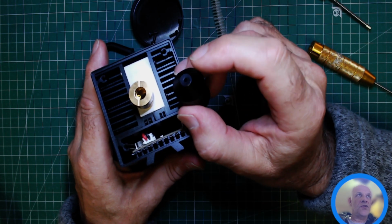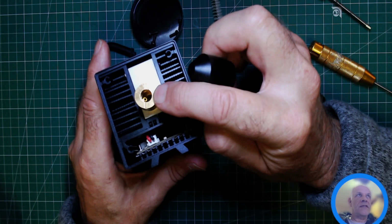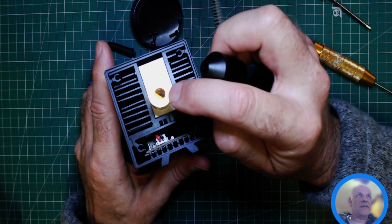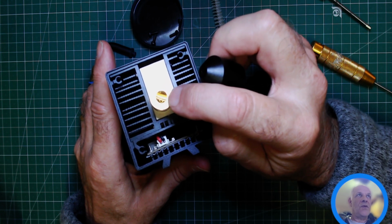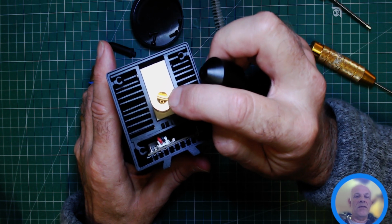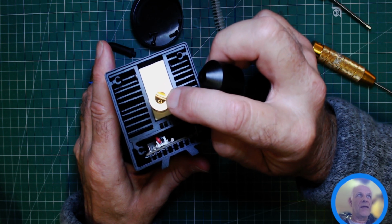It tries to stop the smoke going up this little hole, condensing on the lens, and then the laser light comes through the lens, starts to heat that debris up, and it starts baking itself onto the glass. In the worst case, if you leave it on there and do no maintenance, eventually that glass protection lens will crack.